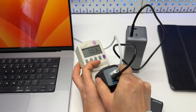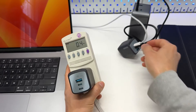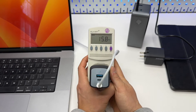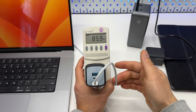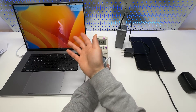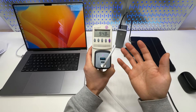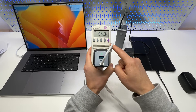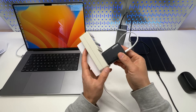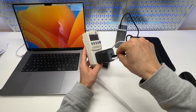There's still one USB Type-A port available, but that's really designed for iPhones or earbuds. Now let's try the 100W version. First, let's max out its power output with the MacBook Pro 16-inch — I'm expecting a little bit over 100 watts. My MacBook is at around 25–27% right now, and I'm getting around 95 watts. That's very close to spec, making it a good replacement for Apple's original charger given how compact it is and the additional ports it provides.